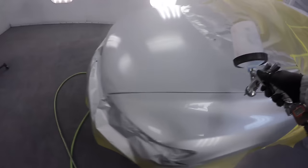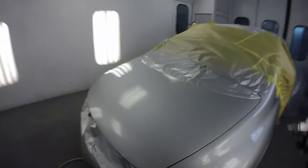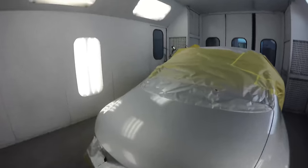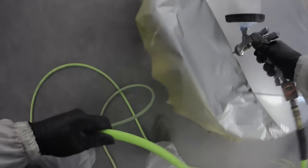I want to talk a little more about blending. When you come to the edge of your primer, you kind of want to roll your wrist a little bit — angle your blends, going upwards or downwards. Don't have a dead stop in the middle or you're going to get a build-up on that edge and you'll see that blend. What happens is the metallics might end up standing up differently where your gun is rolling off, because that spot dries quicker than the rest. Try not to have a dead stop — angle your blends and roll your wrist.